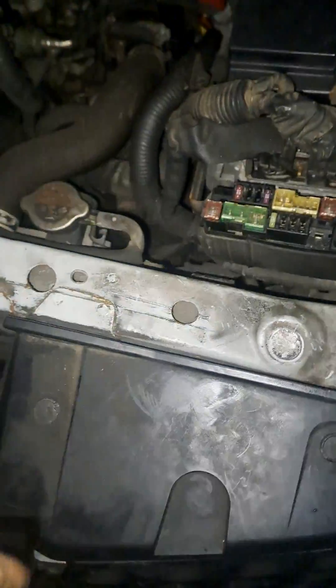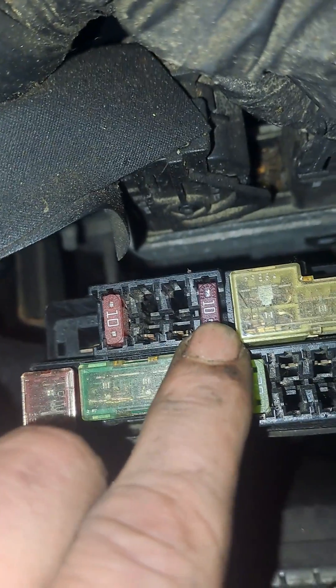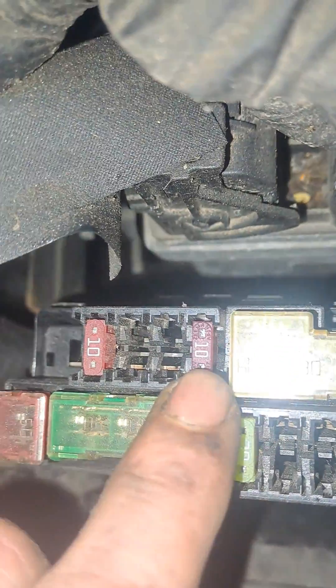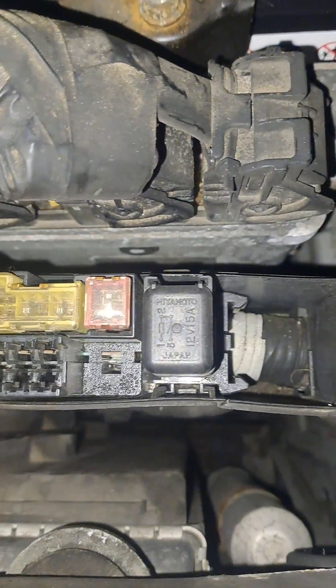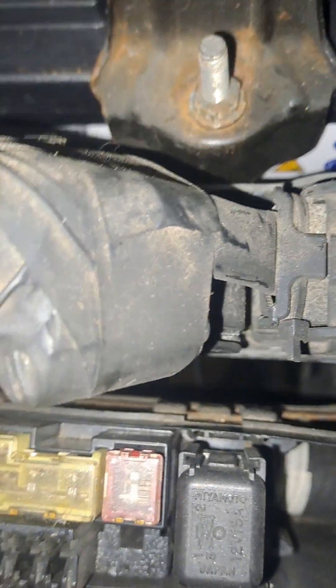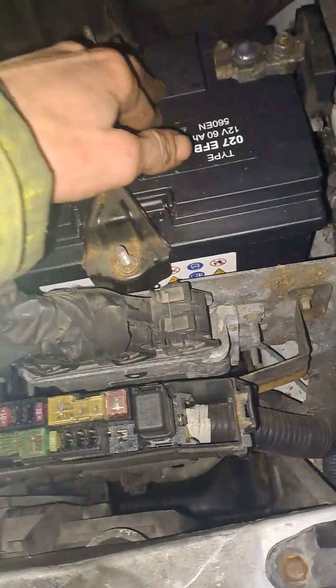As it transpires, I decided to check the fuses first. Namely, this fuse here is responsible for the signal wire for the alternator. This fuse is blue, and I suspect it blew due to the battery struggling, which then allowed the alternator to go unregulated and killed the battery. So it all comes down to a failing battery.